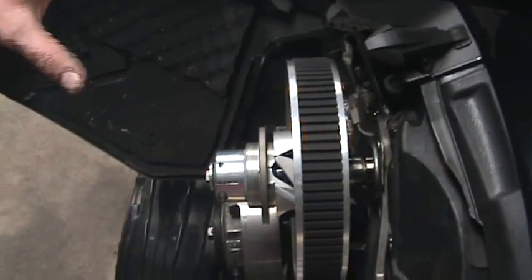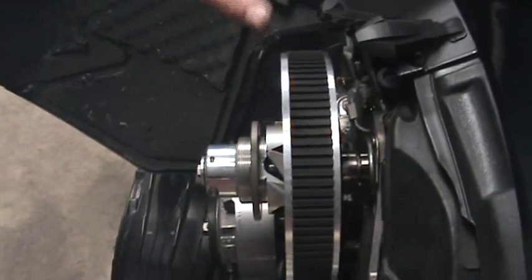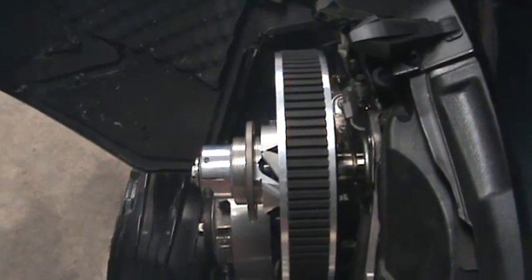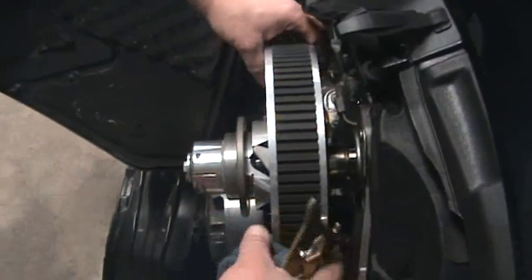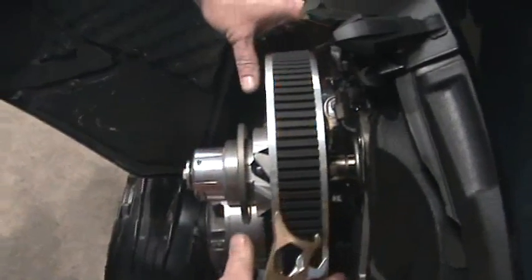You can see how the clutch always follows the primary. It likes to start out with itself in, then it moves out, and as the speed comes up it'll move back in — it'll always find its center. Right now it seems to be fully out when we first shut it off, and that's how much we can move it in.